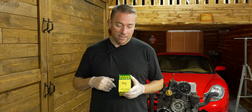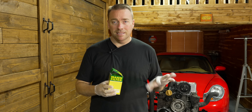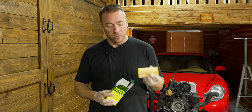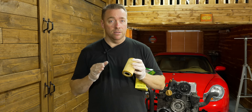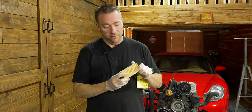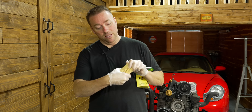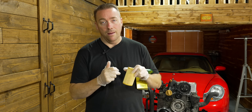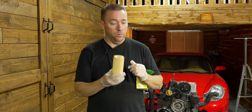Same as BMW, Audi, anything — we always use Mann filters. There's a reason why we use these. They're about $6 to $10 a piece depending on where you buy them. You can buy them off Amazon, but these filters are a lot more rigid. The number one cause of low oil pressure on any German car is the filter will not be rigid enough, and it'll actually twist. When you take it out, it's all twisted and the ribs are actually pinched shut. A Mann filter will not do that, but a lot of other filters will.